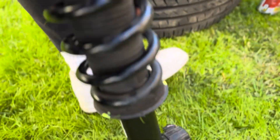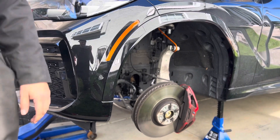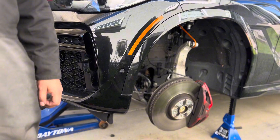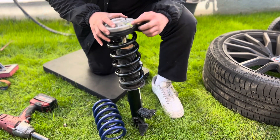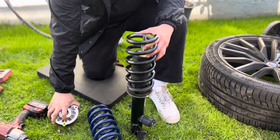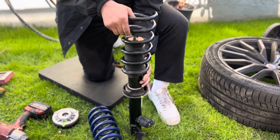Here's the stock strut — it's an 18mm bolt on top, right there. Pretty easy. Right there we have it hanging by a brake caliper hanger so there won't be so much tension on the brake hose. You see how this 18mm bolt right here — I line up this line right here with the sensor, and just mark a line so you know where it goes. This is the stock spring obviously — it's just heavy.